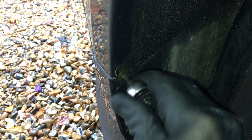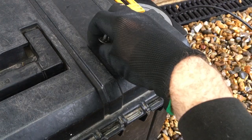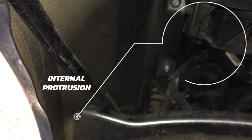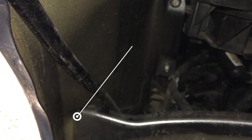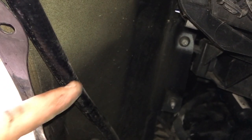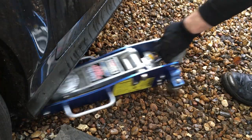I'm not removing all the screws, just the ones at the front. As the wing liner is made from a soft flexible material I only need to unclip it from the wheel arch edge so it can be pushed aside easily. Looking behind, we have quite a nice open area in which to work, and we can see the internal protrusion that caused the high spot mentioned in my analysis. Because of the drain pipe here I'll need to push it aside to prevent any damage when pushing behind. Finally I lower the vehicle so the gap is sufficient enough to get some good leverage from the tire if needed.